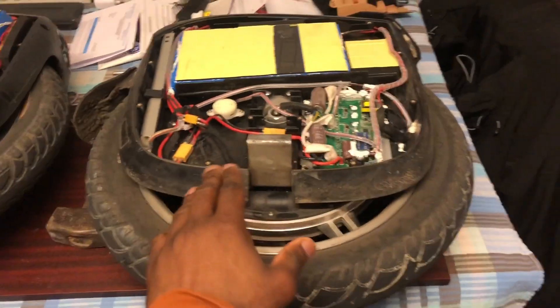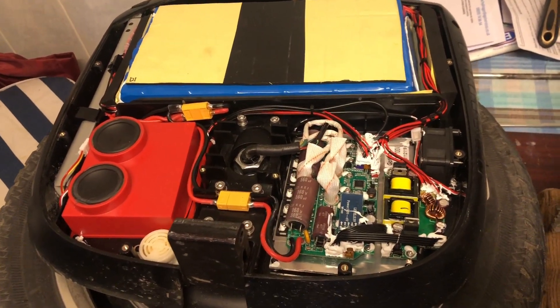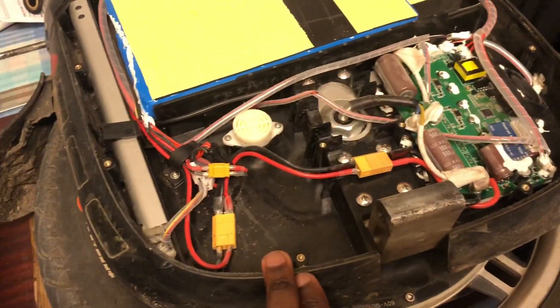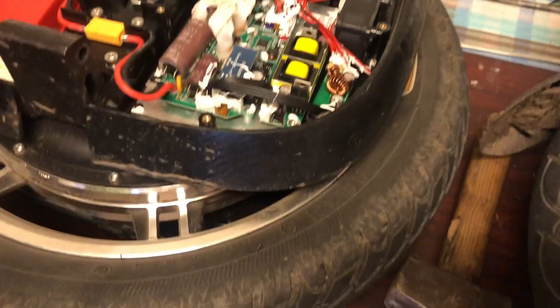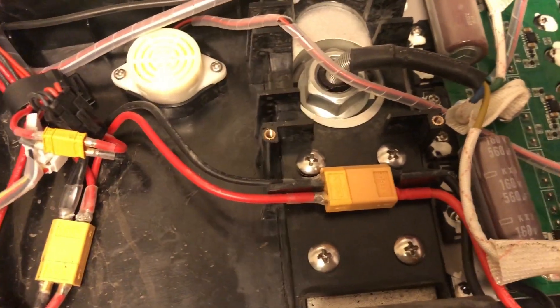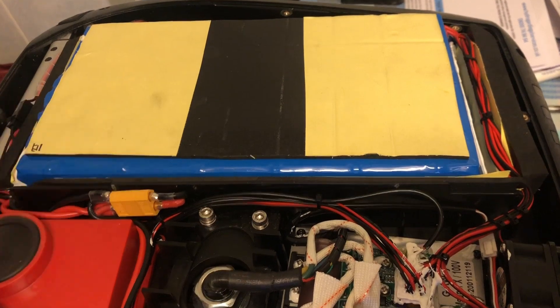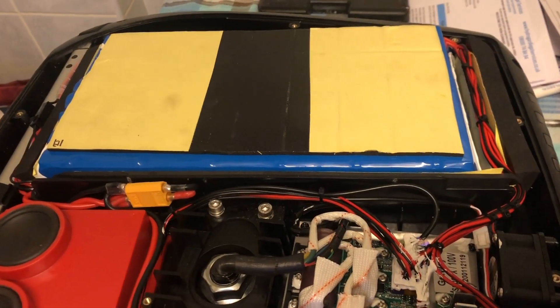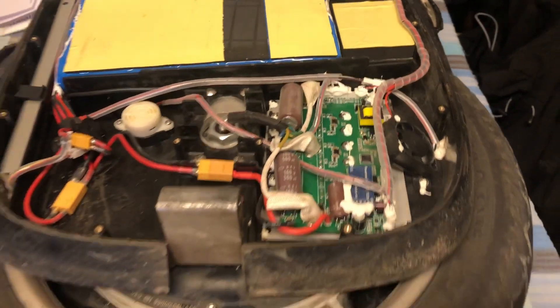This is the MSX 100 volt 1230 watt-hour internals, and here are the MSP internals. The MSP has a speaker, a better fan to cool down the main board, and allen key improvements that make it more robust and easier to take apart. The obvious difference is also the battery packs — the MSP uses 21700 cells, which are bigger and take up more space, giving you more range compared to the MSX's 18650 cells, which are a smaller pack.